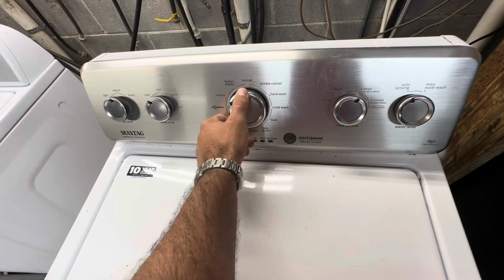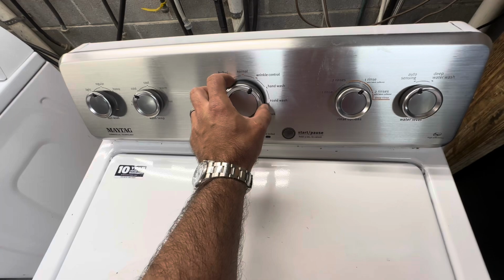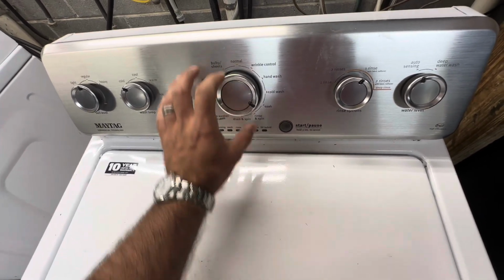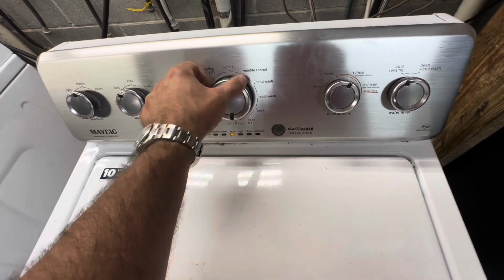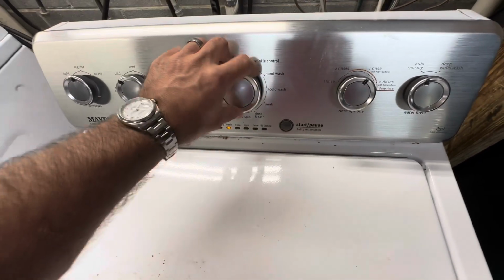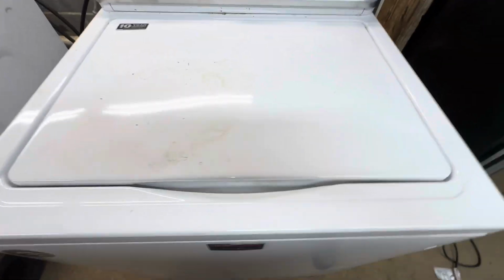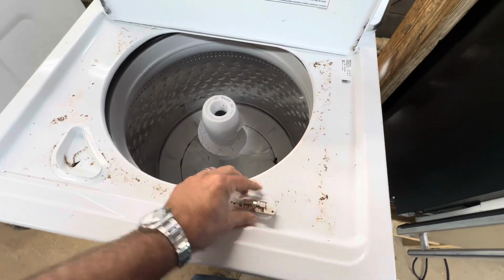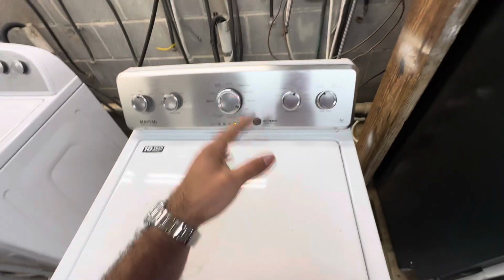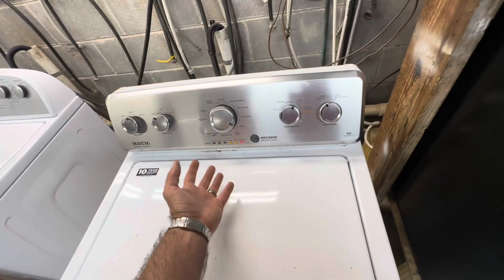Okay, so we might as well do an auto test. Left, right, right, right, left, right, left, right, right, right, left, right. Okay, flash mode, codes, auto test, manual test, recalibrate, and then you can even test the speed sensor test where you can turn the drum, but let's just go to an auto test. Where's my jumper? Here we go. Jump the switch. Give it a go. It's gonna fill with cold, then it's gonna fill with hot, then it's gonna fill with cold and hot, and then we're gonna shift and wash.